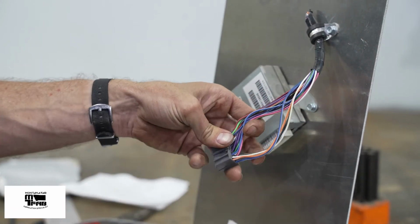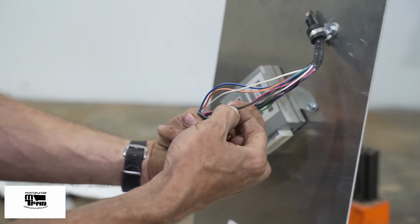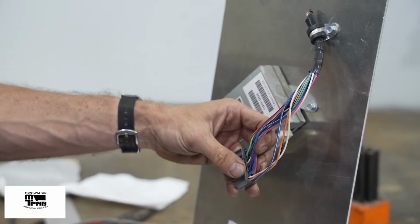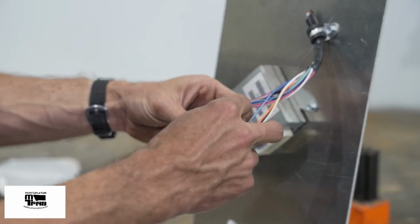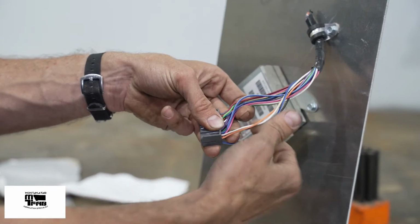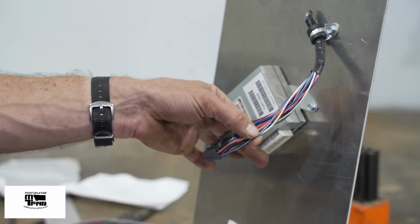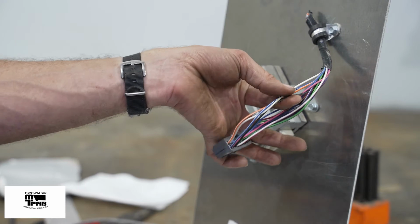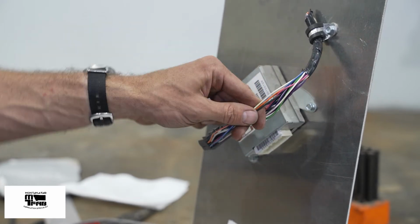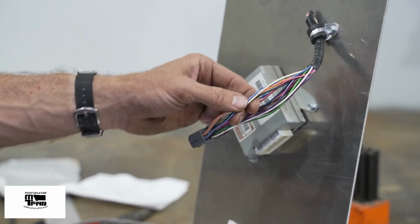And in addition, as another double check, I am cutting pin 24, 26, 25, 24. 25 is the pink wire. 12 and 13, which are on the opposite corner, white and orange. I'm going to cut them about 1.5 inches up. I would like to get further away, but the farther away I get from the connector, the deeper I get into the brackets, and it's more difficult to splice.